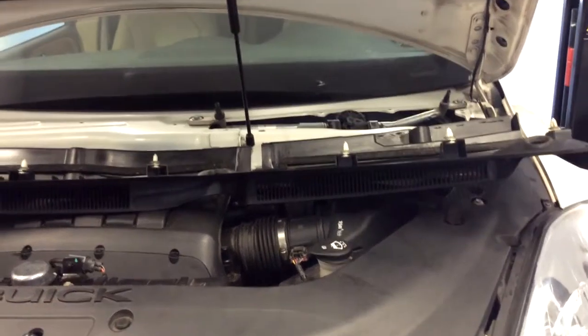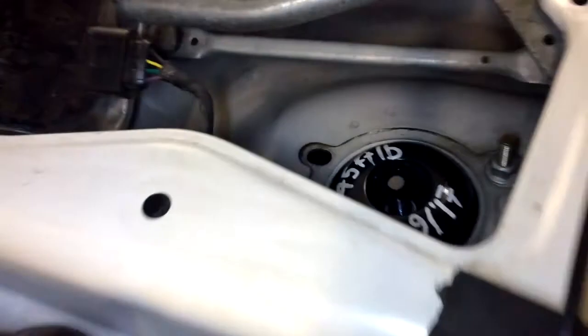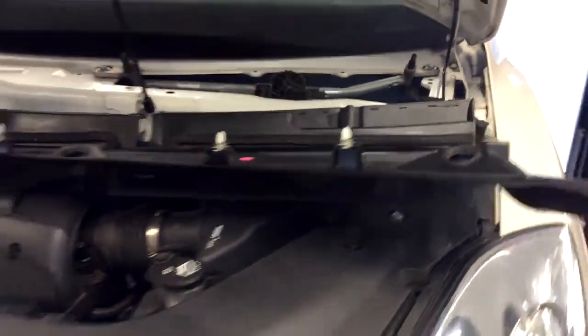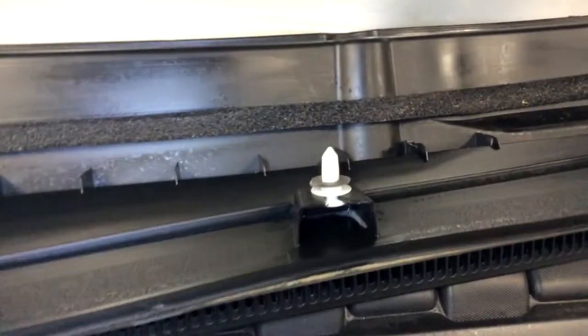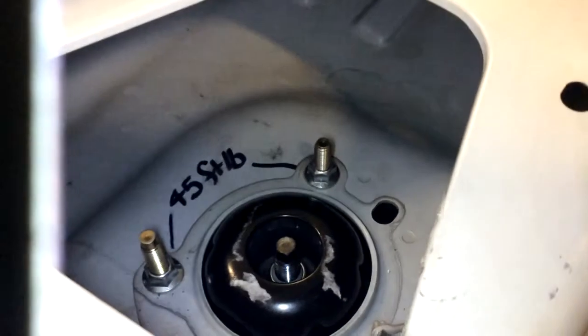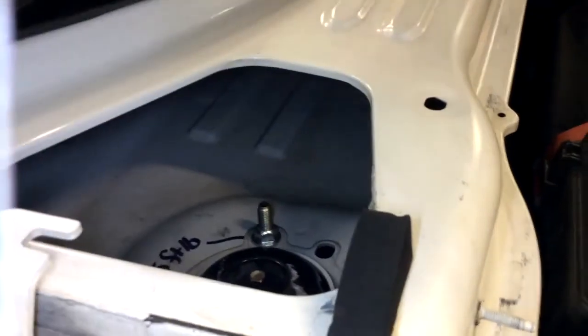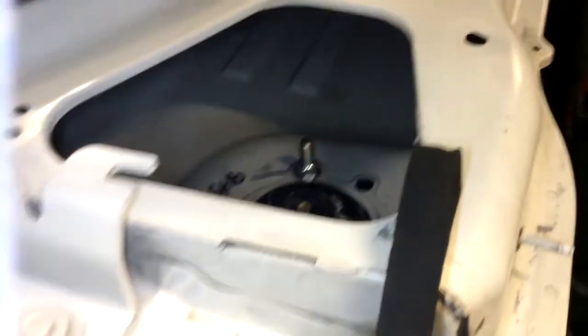Okay, I want to show you this one more time before I button it up. Got it cleaned up pretty well. Got those things torqued down to 45 foot-pounds. You can see all the white clips are in there. Proper position. And got these put on. And I want to do things like vacuum out that cavity and get little rocks or leaves and things in there that just aren't going to be good over the long term.